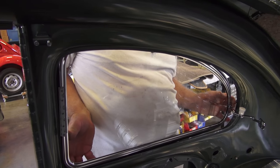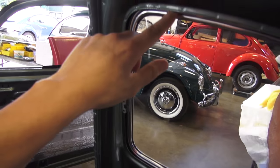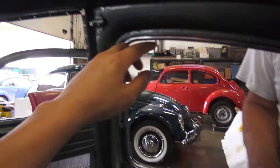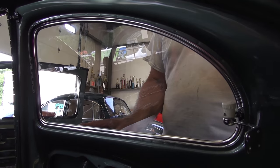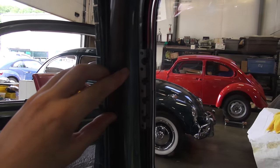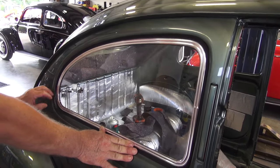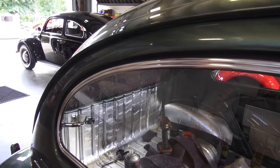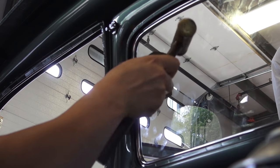Apply it liberally. You need two people for this job — one on the outside, one on the inside. Set the window into place and make sure it's even all the way around so the chrome is even and the ribs are shown evenly from top to bottom. You don't want it too high or too low. As you can see here, the ribs are shown perfectly all the way around. You're going to want to get the hinge over that lip in the window opening to get it started. Come to the outside and make sure the window sits evenly, with no gaps — otherwise when it rains you'll get water coming in.